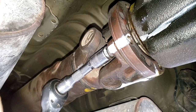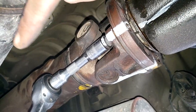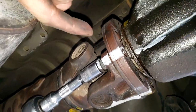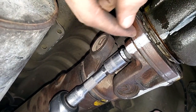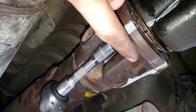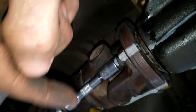We're just undoing the last of the four bolts now. When you take this last bolt out, a couple of things could happen. First, the drive shaft could drop — so I've got a jack stand almost pressing on the drive shaft so we can lower it slowly. Second, the drive shaft surface may be partially seized to the flange. In that case, thread the bolt in a couple of turns and tap the area with a hammer to disrupt the mating surface. With the bolt in a couple of threads, the drive shaft won't just drop and hit you in the head.